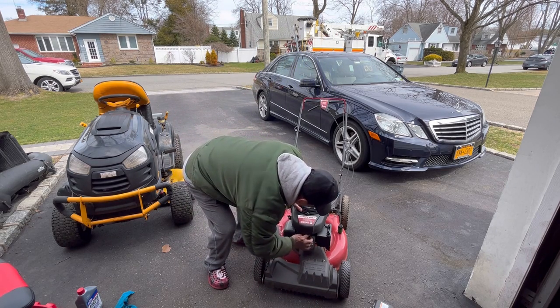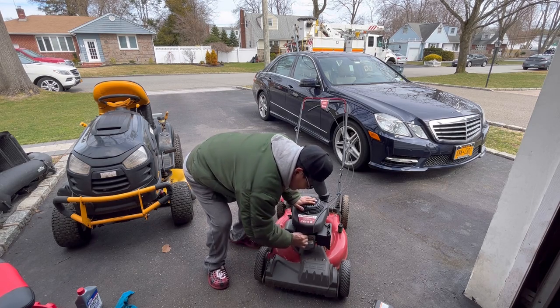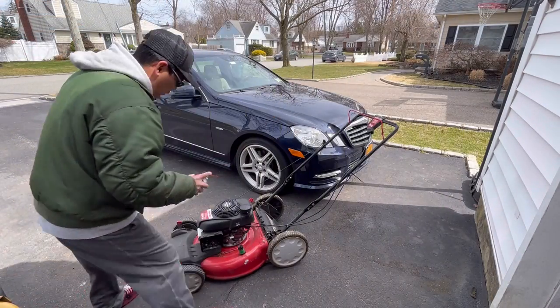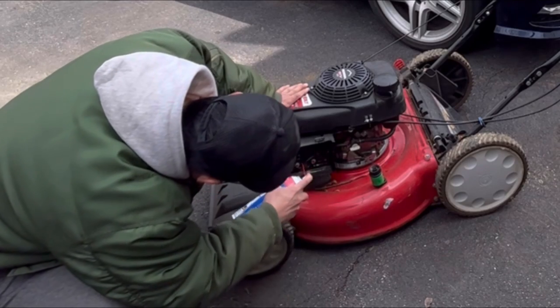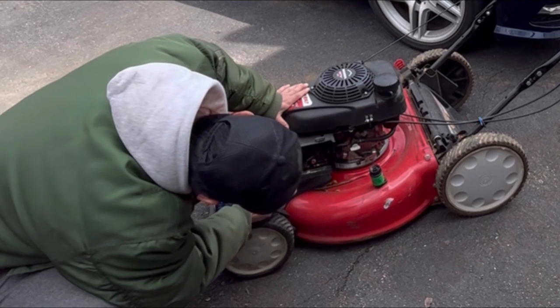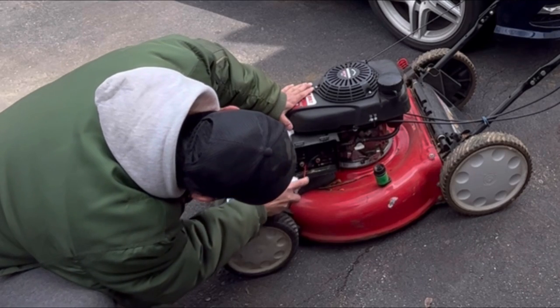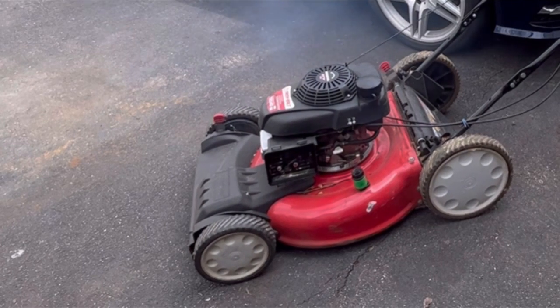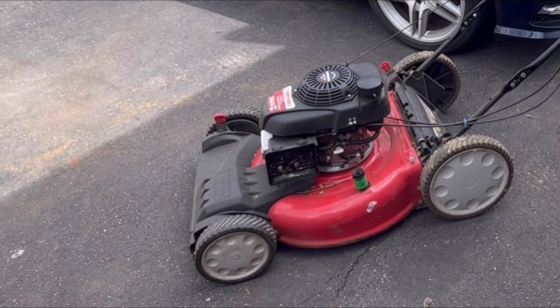Spark plug, let's see, this wire is in there, moving it around so it makes better contact with the metal. So get some starter fluid. Okay, the PSEG guys finally went home and we now have power. Spraying some. You know what? Choke flap is kind of stuck, won't open. Okay, starts with starting fluid, which is good. Engine sounds really good. I have a feeling the carburetor's dirty.